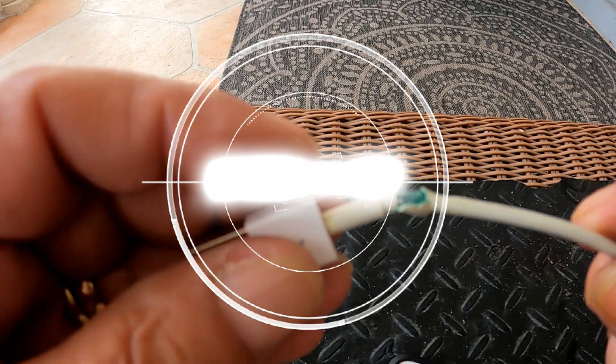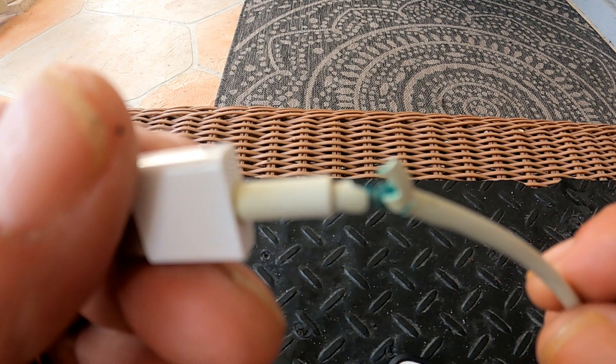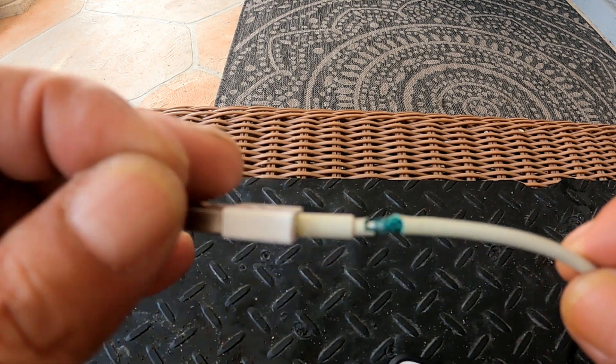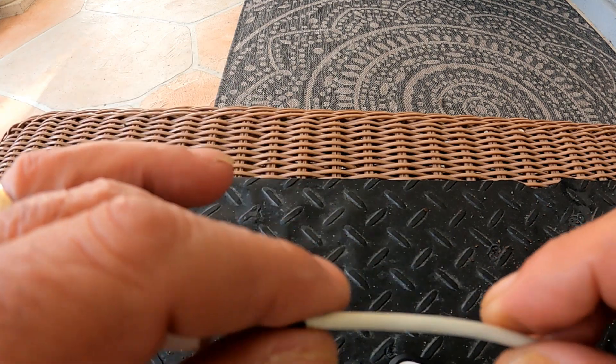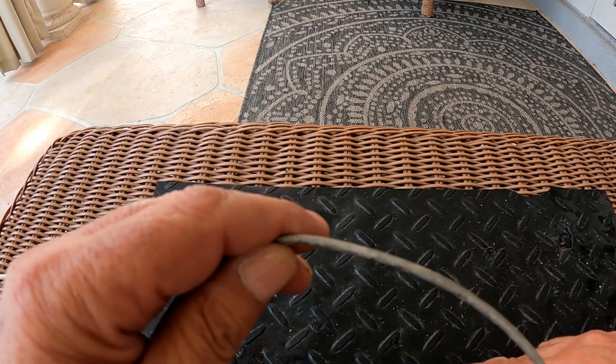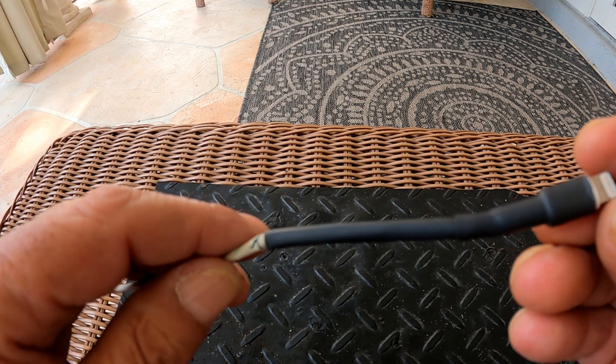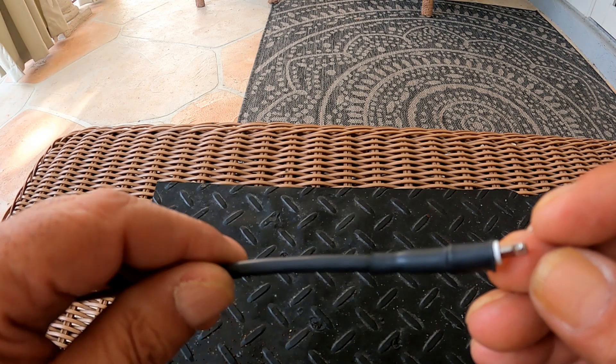This is how I fix the cell phone or tablet charger cord instead of tossing it away so I can use it in my garage. Over time the cover of these cables usually breaks exposing the wires. If you catch it on time you can fix them like I did to this one almost two years ago, using shrink tubes usually used on low voltage wiring.